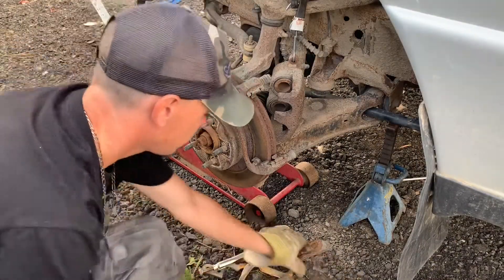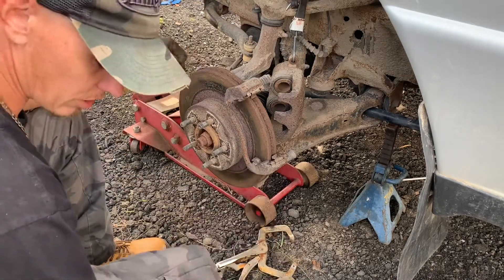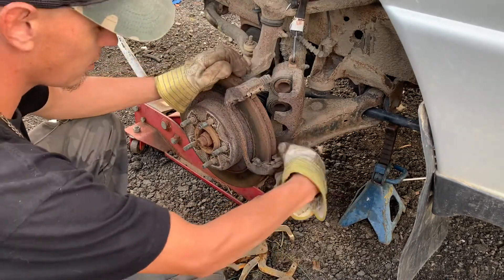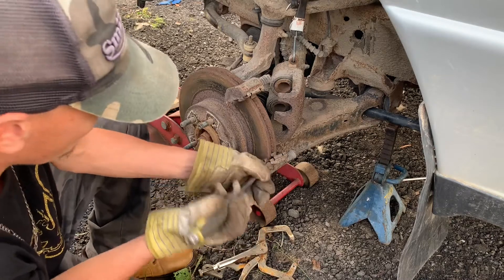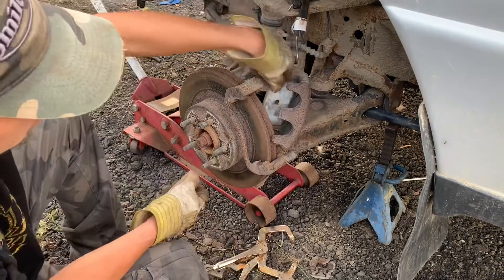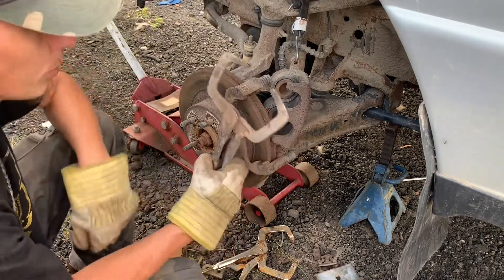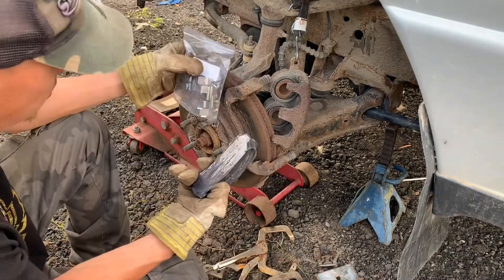I'm on the driver's side now and this side actually exists — there are actually brake pads here. They're not very good, they're terrible, but at least they're not worn down and missing like the other side. I'm checking everything and I'm going to change the stainless pieces. I'll clean the cradle and put the new stainless hardware in there. I pressed on both pistons with this handy dandy squeezer magic tool. I returned those and I've got the ceramic pads and hardware here.